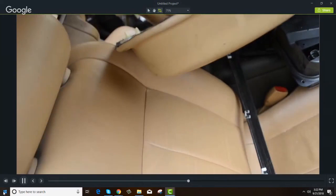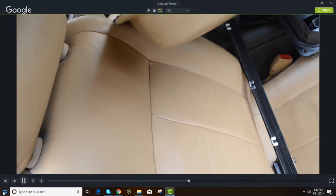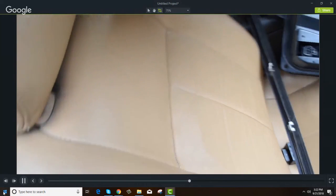Something I forgot to tell you as well — this center pillar: if you can't get that bottom cover off, get that off as well, because when you start prying the door back it'll start going forward and move out of your way just enough. You've also got to get the seat up and out of your way.